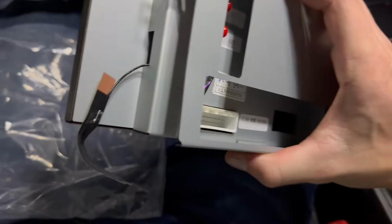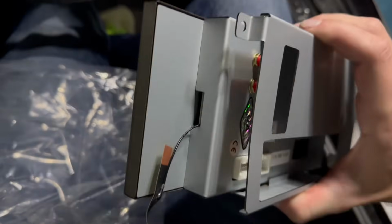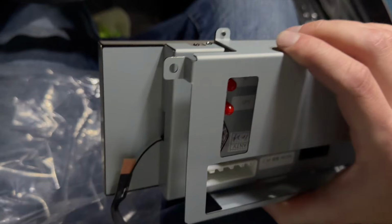One thing I've noticed is this little antenna. I'm not sure where we're supposed to stick that. So if you remember from the beginning of the video, this is one of the things where I'd stop and take the head unit apart, so you can remove it from the bracket that it's on, which I'll show you soon. And then there's similar Phillips screws on the back, and you'll be able to lift off that bottom cover and basically throw away that Wi-Fi antenna.